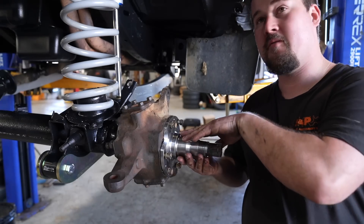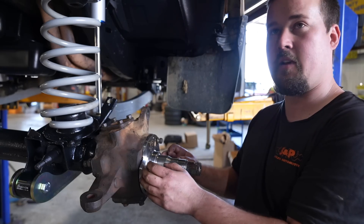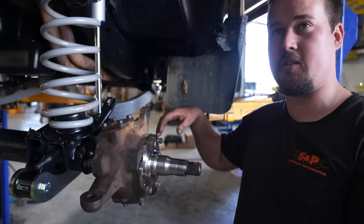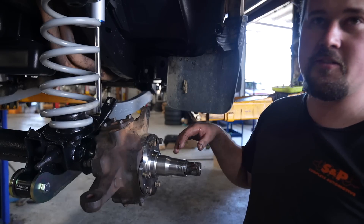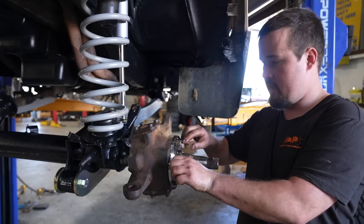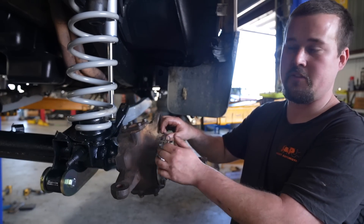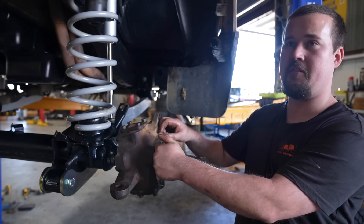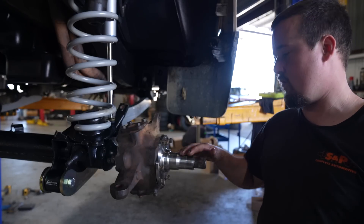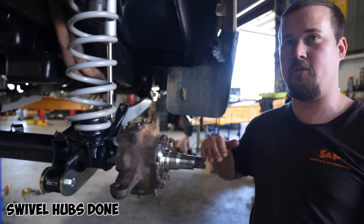New made-in-Fuji Japan spindle — good quality. Normally these have a backing plate which we're going to leave off, because mud gets stuck in there and then you get a big squeal and wear your rotors out. So we take it off because you're an extreme off-road driver. These little things and this gap here is for a model with ABS — they normally have a sensor that comes through, but you don't have it. Wheel bearings go on this — I'll raise this up, put the wheel bearings on like we did last time, put it on, tension it up, and that's the swivel hub done.